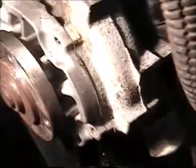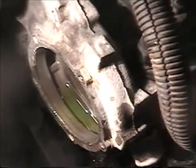With all the bolts removed, I'm going to tap on it and it pops it off. This is the water pump here. Take a look at it and see if there's any signs that it might have been leaking. When you remove it you want to clean off the surface here — make sure all the old gasket has been removed. This one looks pretty clean but I'm going to scrape it anyway, without cutting into it. You don't want to do that in order to give it a good seal.